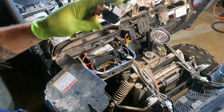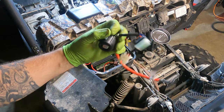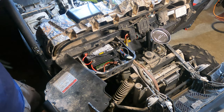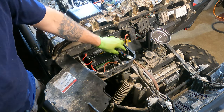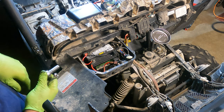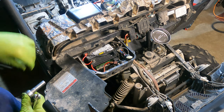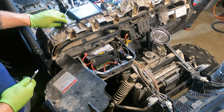So the next thing we're going to do - I got a new starter relay for it. It comes with a positive battery cable, a new fuse, everything right there. It's pretty much plug and play. We'll go ahead, the hot side, the positive side of the battery, and then we'll remove this, unplug it, put the new one in and we'll turn the key and see if it turns over. The throttle body is still hooked up in there - it's not on the intake so it won't fire - but we'll know if it turns over and that cured our issue, which I'm pretty positive it does cause I've replaced these a bazillion times.